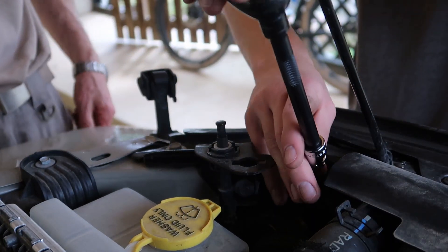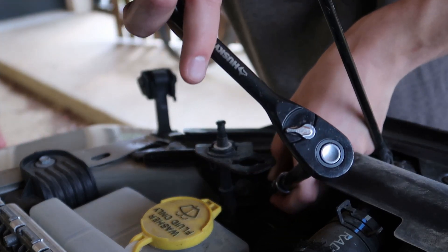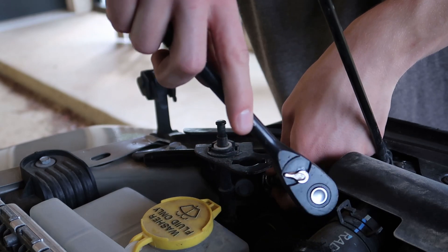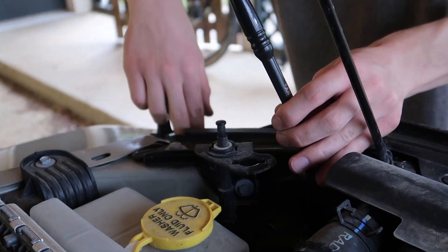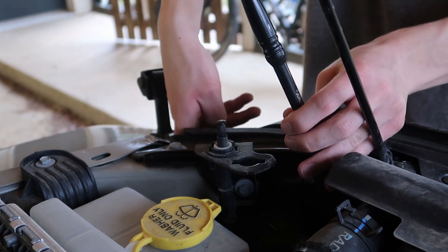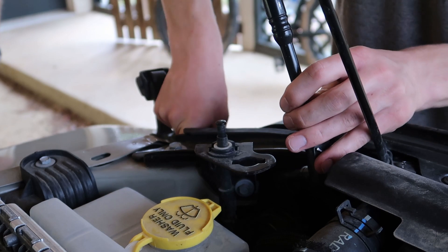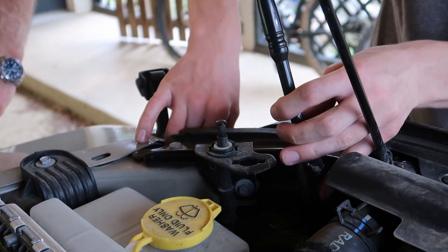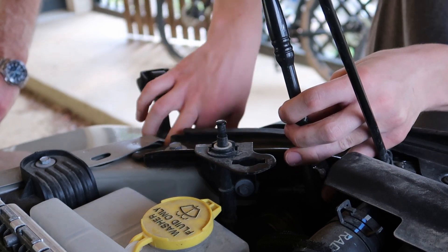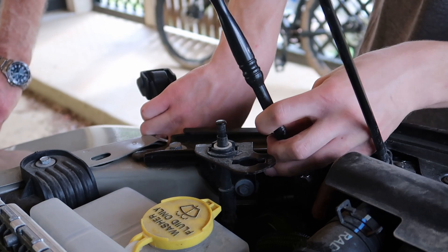So we're about to start loosening this up. You see a lot of videos on YouTube of people doing this and they make it look pretty easy — it's actually not that easy. I wouldn't say it's the hardest thing to do on a vehicle, but it's not easy at all. The hardest part is just grabbing your socket because with the swivel it's always going to follow gravity and go down, and you have to remember that bolt is not level — it's actually angled down. So once you can hook on it and feel it with your finger, you can get that socket on there.